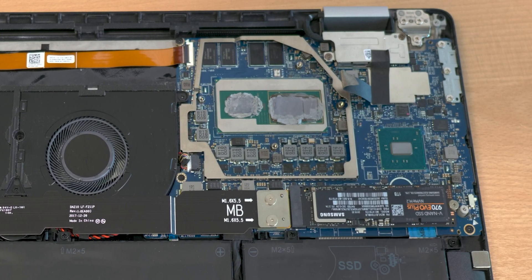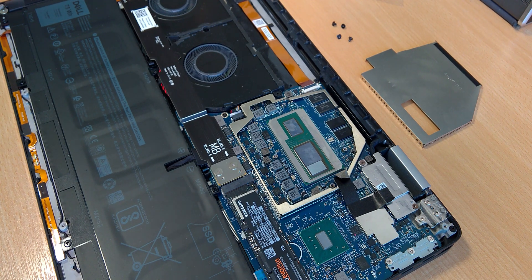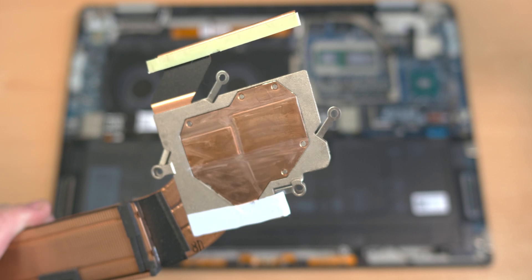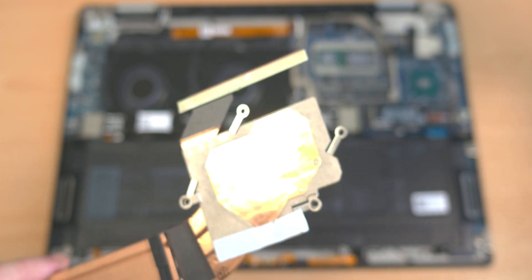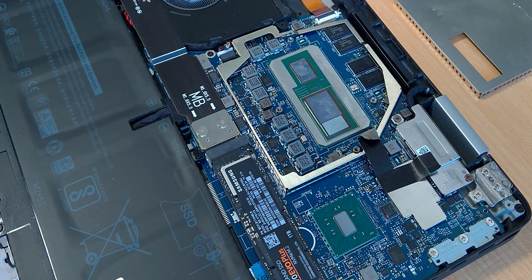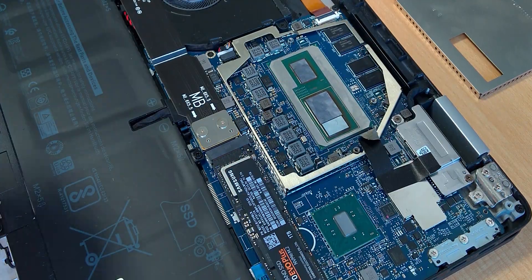When you're done it should look extremely clean, but we need to use the second step with the purifier to make it even cleaner. You can also use normal alcohol if you want, and do the same on your heatsink. I have a copper heatsink here which is perfect, but keep in mind I'll tell you something about copper at the end of this video. Now we just use the purifier — essentially normal alcohol — to clean the dies as well as the copper plates of the heatsink.